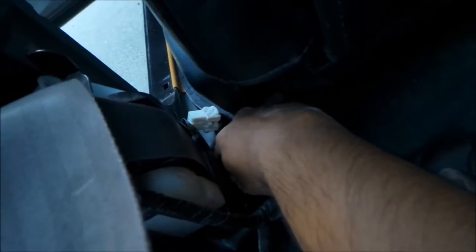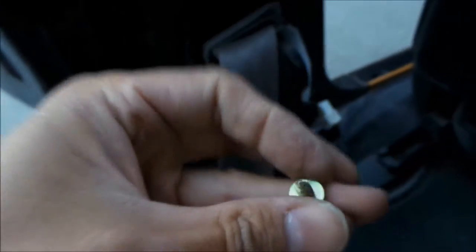So I'm kind of trying to figure out how this all goes in here. I'm just putting the new retractor in, bolting it on. So to get that one part here bolted - or screwed onto the chassis - I'm going to have to drill a hole, because this one doesn't have that hole. So it's like right here - that's where the hole's going to be. I got my punch here, my drill there, and the screw. The one in the junkyard had one there. And I'm assuming if I drill a hole in there, it's not going to really do much - so I might as well just make it complete, right?